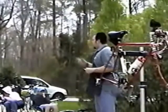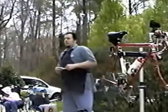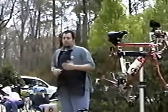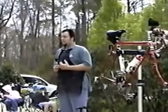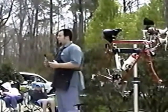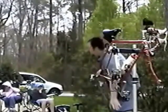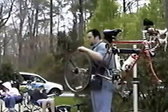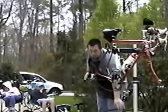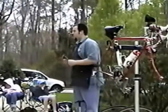Now, one reason the gauges for car tires don't always work is that you rarely ever see a car tire that goes more than 50, 60 PSI, and that's even really high for a car. So the gauges aren't calibrated to go that high. They probably wouldn't even reach the 150 PSI that this tire could handle. Many of the bicycle tire gauges are calibrated to go up to the very high pressures, but they will also handle the lower pressures of the mountain bikes.